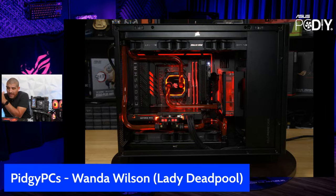So that's our micro ATX-based AM5 motherboard, a Ryzen 7 7800X3D, then the Corsair Hydro XC8, so yes, that's the Core Sense CPU water block from Corsair. He's got 64 gigs of DDR5 memory in there, so that's going to be 6000 MT/s CL32. Considering this is a Gene board, you could probably even tighten that up. You could maybe get CL30, maybe even a little below that if you want to manually time it. But that's already fantastic. I mean, very nice performance.